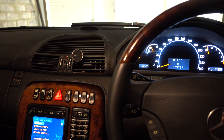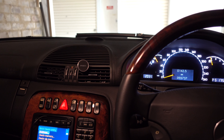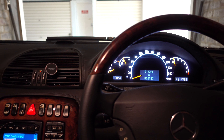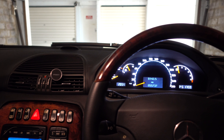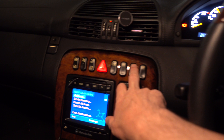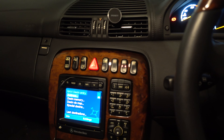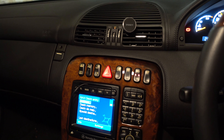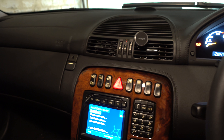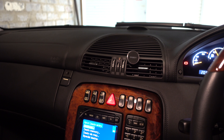One of the issues I've had in the past — and it didn't do it today — is that I get a warning on the dash when you start it up to say that the car is too low. I think what that is, is the ABC suspension is actually settling down and losing some pressure somewhere in that system. It can be quickly and easily resolved by just pressing the suspension height adjustment, and as soon as you do that it corrects itself — it pumps up the system again, gets the vehicle to the right height and then you can drive it as normal. I'd be interested to know if anybody knows whether that condition is normal behaviour or whether it's actually a problem or an incipient problem.